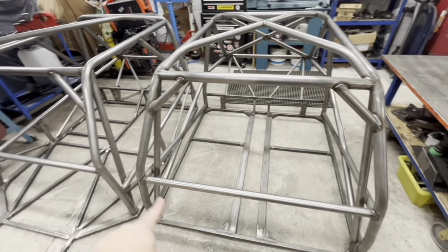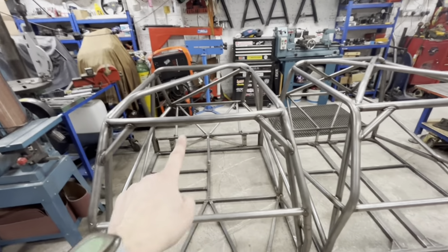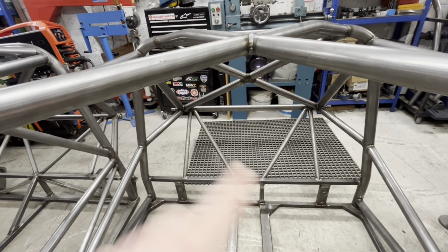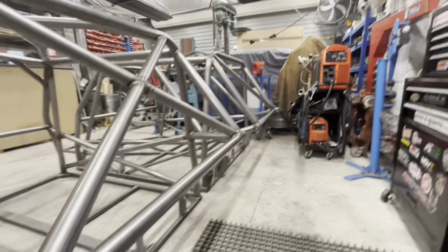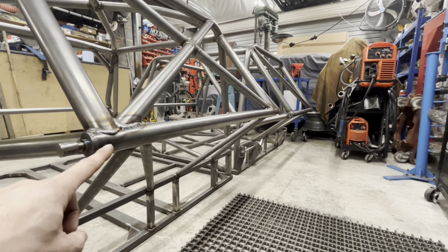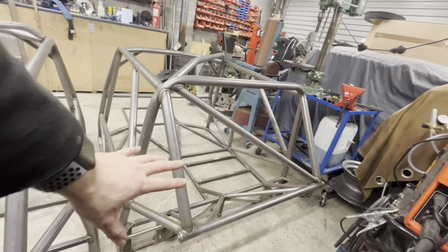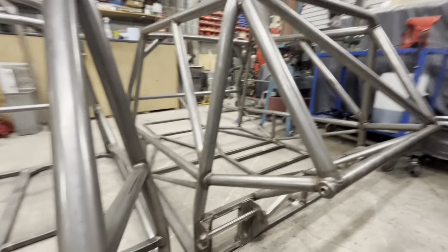So that is about all of the similarities in these two chassis. Yes, the dimensions are the same — same length, same width. The rear end is nearly the same, apart from the centre spine: this one has only one, where this one has two verticals. Before we even get to that, I'll show you another difference round the back. That is 50 millimetres lower than this one, and you can make out that this section here is smaller than this section — this is more wide open.